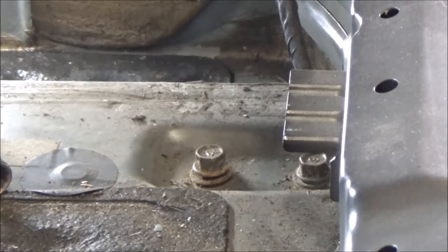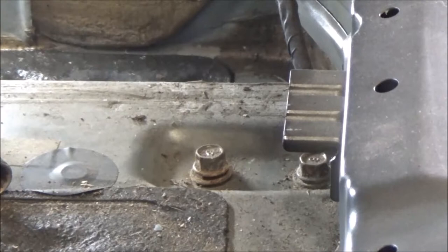That stanchion face plate has become loose, so I'm going to take those bolts out. That's where the new chassis rail supports for the cross member bolt in. There are also more holes to drill through that line up with holes in the bottom rail, where you drop the bolts through and tighten up the nuts. The plan is to put those on using those two bolts as a guide and use the plate as a template for drilling the new holes, which should locate with the holes in the chassis rails underneath the car. So far it really looks like it's lining up, but I may not have actually needed to take the plastic cross member off the mounting plates — they didn't make that clear in the instructions.